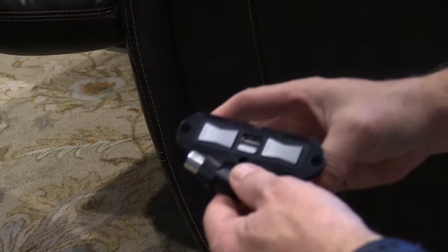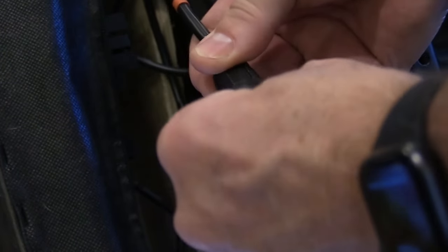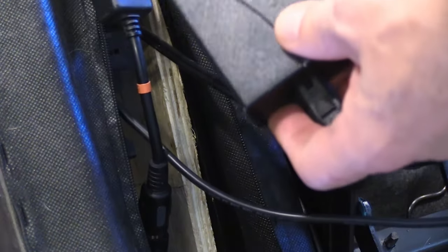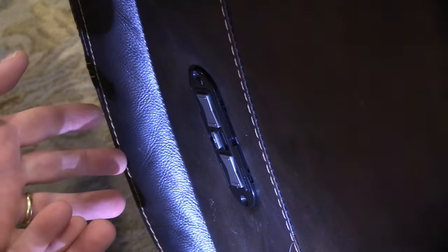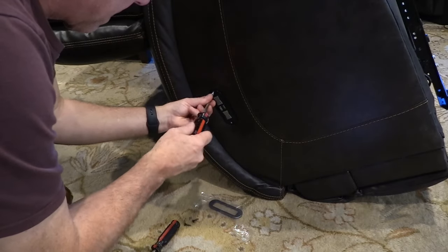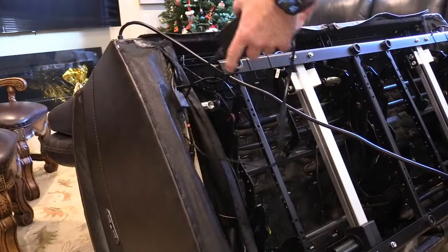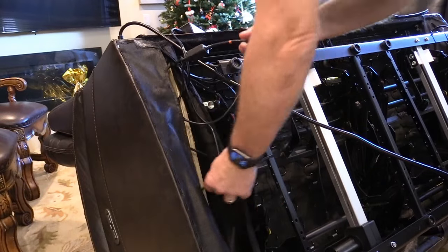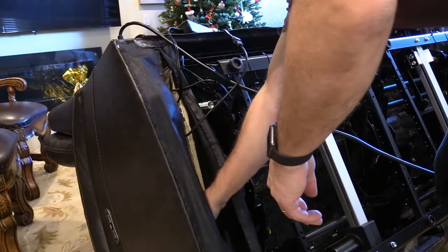To replace the switch, simply slide the cable through the open switch hole. Reach in, grab the cable, and connect it to the other end of the outlet. Once you've made the connection, check your transformer — the green light should be on. You can now fish the rest of the wire through the hole, and then gently nest the switch into the armrest. Reinsert your screws, tighten, and place the faceplate over the top of the screws. You might want to test it before you tighten all the screws and zipper all the wires back up.